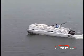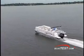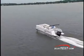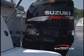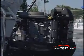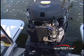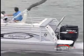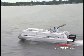This Neptune 23 combines ample space with great performance — over 38 miles per hour from our test boat's 200 horsepower Suzuki 4-stroke outboard. Built on a 3.6 liter V6 block that was first introduced as a 250, this 200 shares many advanced features of her bigger sibling, most notably multi-stage air induction for better low to mid-range torque, and digital electronic fuel injection, which has been standard on Suzuki 4-strokes for a decade.